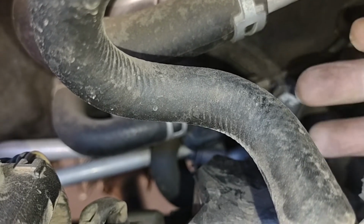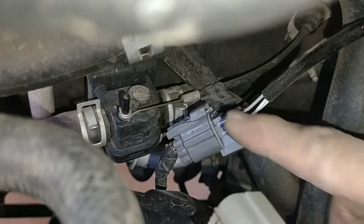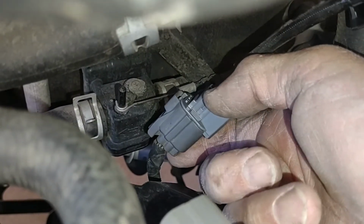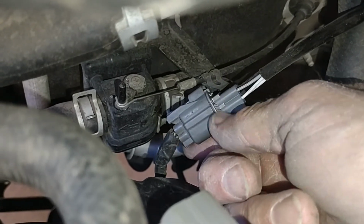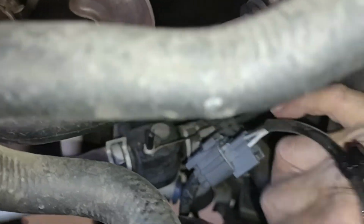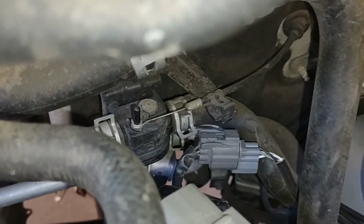reconnecting the new plug, making sure you get it lined up properly. When pushing it together, be sure to push down on the little release here when you slide the two bits together, and it'll just slide home. Just make sure it's fully seated. You do not want a gap right here, or you could have intermittent problems in the future. So now the trick is to put the sensor back down the way it came out, and it should be hanging right down where you'll be able to install it from below.